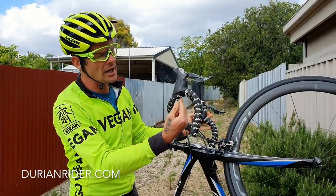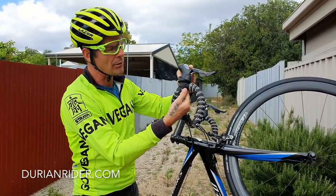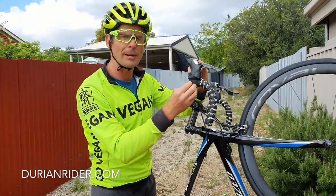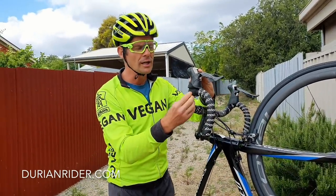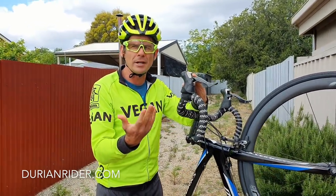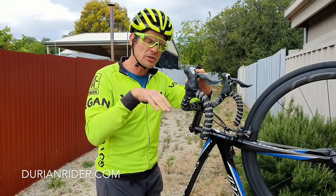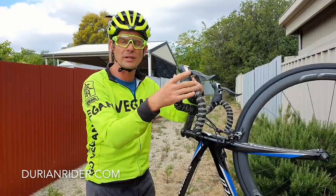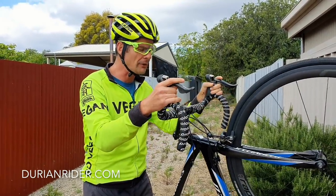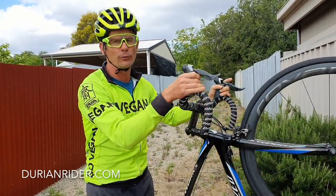The third most dangerous area is under here — especially with carbon bars, you'd have to take the bar tape off and inspect that bracket area. Make sure you mark it with a white-out pen so you can put it back to where it was. Check for any corrosion. If you're a really sweaty person, or maybe a meat eater, that meat sweat — I've seen bars literally snap in half because the meat sweat, especially on the home trainer, dripping onto the bars, basically corroding through the bar tape with alloy bars. Meat sweat is causing bar failure. One, two, three most dangerous parts for catastrophic failures.